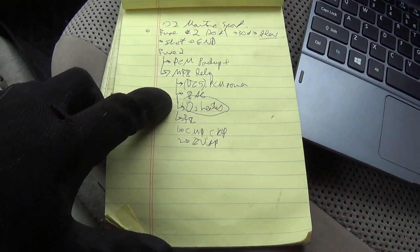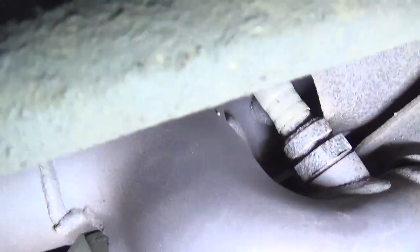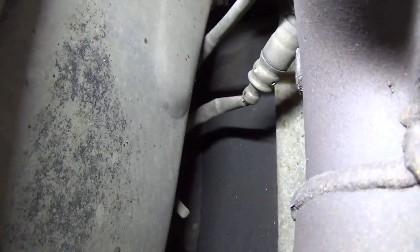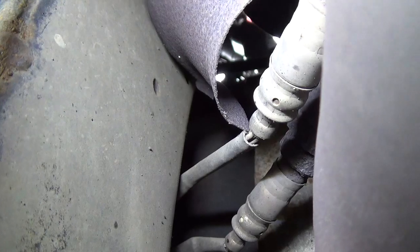Now let's grab our light and look at the downstream O2 heaters. There are four oxygen sensors here total. Working on SUVs is kind of nice. Here are the two downstream sensors — they're actually right side by side. You can see one and one hiding. So we have two pigtails, two options of something. The harness kind of goes along the frame rail. Check this out — this looks very suspicious. That heat shield right there, and the sheath is not protecting that wire.